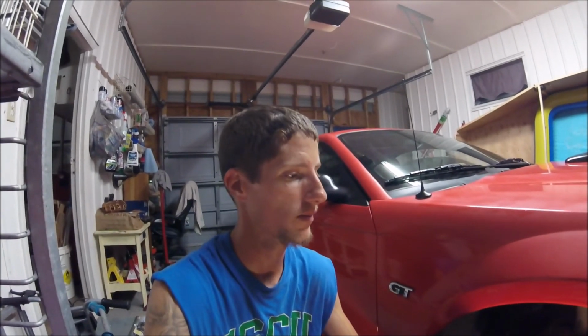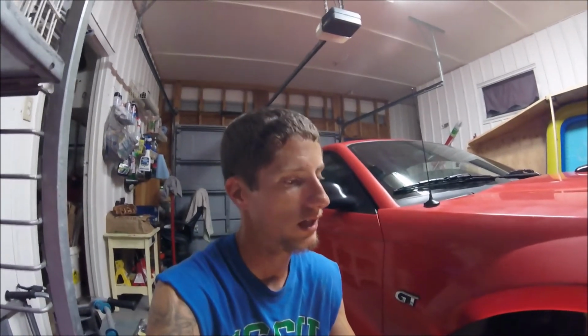I got the tune back onto the stock injectors. The car does have 24-pound injectors, but it was running better off the tune, and on the tune, I put it back to stock injector size, and it seems to run a little better. It doesn't have that crazy idle like I showed in the last video, where it wants to act like it has a cam in it and have that little rough idle for the first 30 seconds or so. So it doesn't do that no more, so that's good.